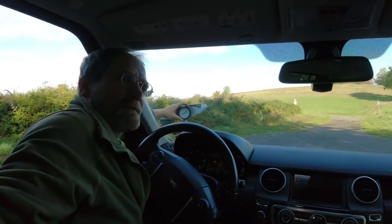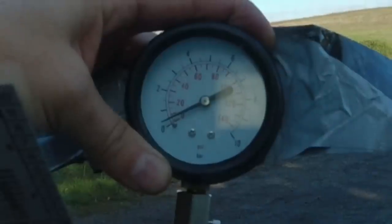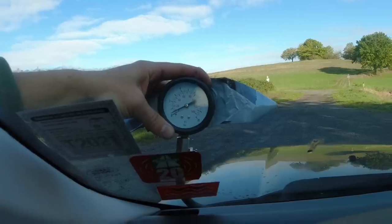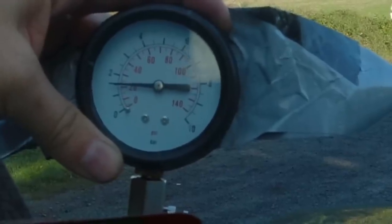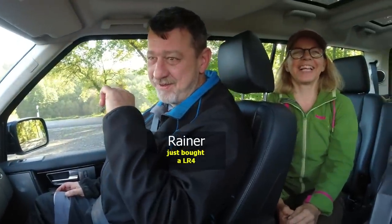This is below spec. You need a new discovery, Rainer. And here we are at 0.5 bar. So this is below spec. We're going to go to three and a half thousand. 1.75. And there we are. That's what somebody looks like who needs a new oil pump.